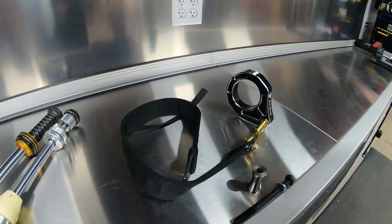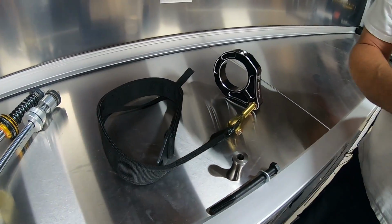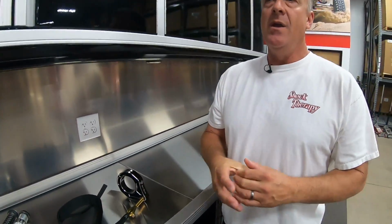That is the suspension falling all the way out and hanging on the shock. When it hangs on the shock, you pick up that clunk, and that clunk means that you're causing a bit of damage to the shock, basically. Now, most of the shocks are strong enough to put up with this for the life of the UTV. That's why we always told people just deal with it, because it's just kind of annoying, but it's not going to hurt anything. Well, that's true, but now that everyone's throwing 33s and 35s on cars and the extension weight, unsprung weight is getting heavier, the load on the shock is getting higher, and we're starting to see some failures in brand new UTVs. What is actually causing that?